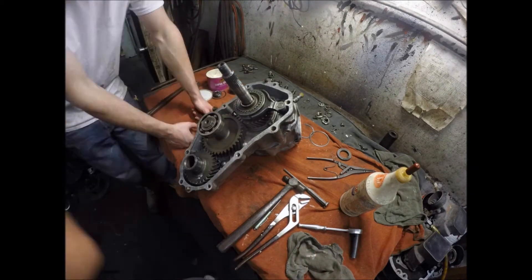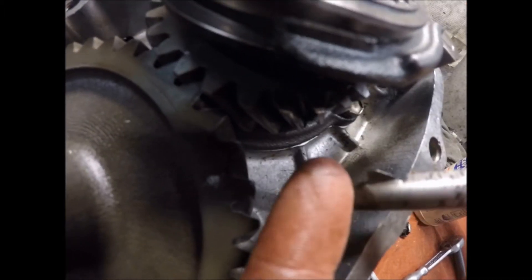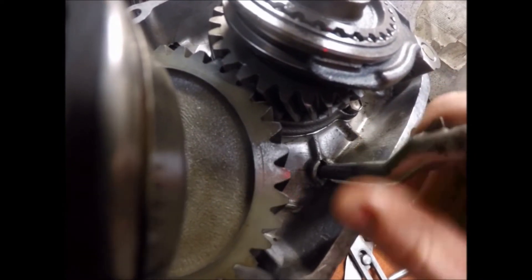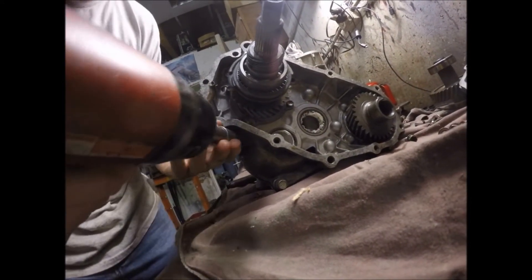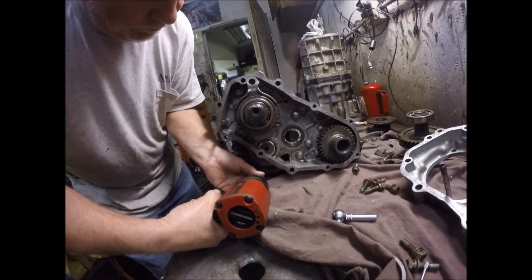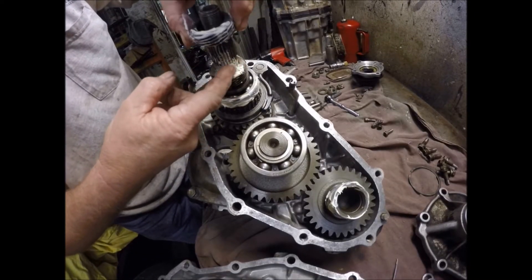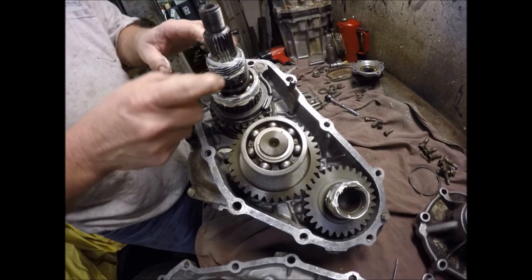There are oiling tubes in here. When you're putting in these oil guides, there's a groove right here — you're going to point the little wing on the side right here into that groove, like that. You can do the same thing on that side too. Use that technique and be very careful. When you install this, there's a ball to hold this in place. It's just an oil slinger. If we put this together, we're going to make sure we put the rear flange on — otherwise this can slide off.